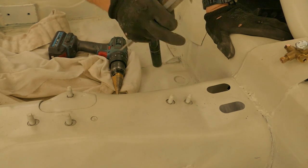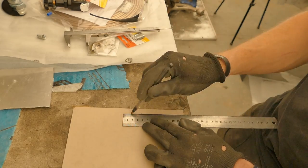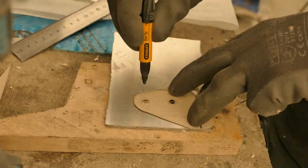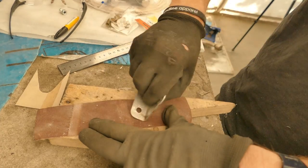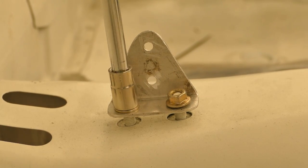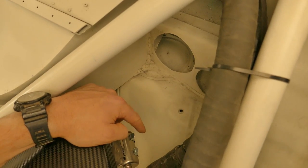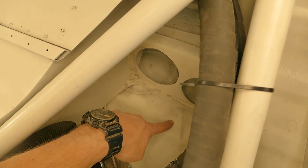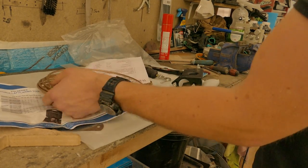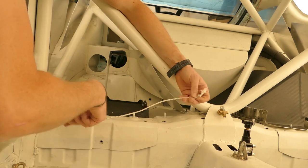Next I'm going to make the mount that will hold the bias valve. I've had a good look under the car for the best position for the brake line to come out, and it's there — what I need to do now is drill this out so I can fit a brake union through it. In order to figure out the length of the brake pipe, I will run this cord in the route it's going to take, and this should give me the rough length.